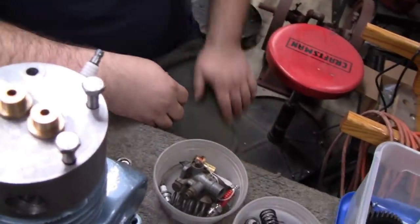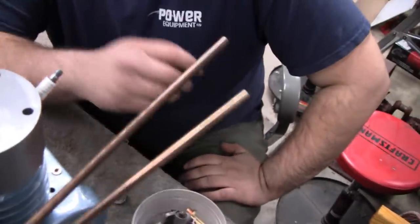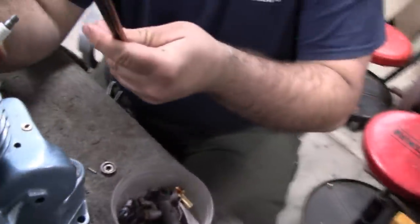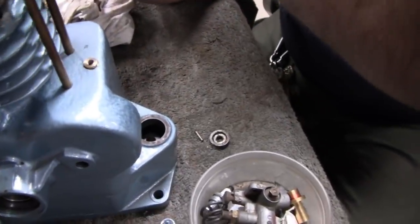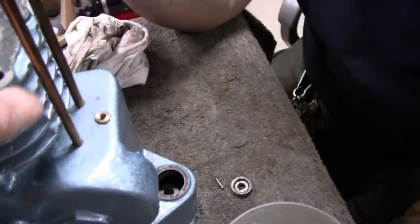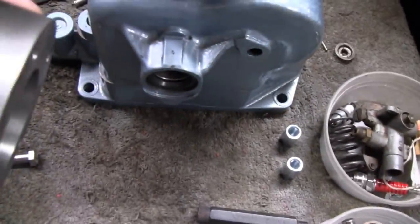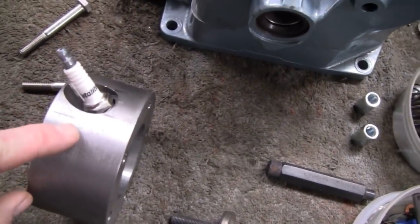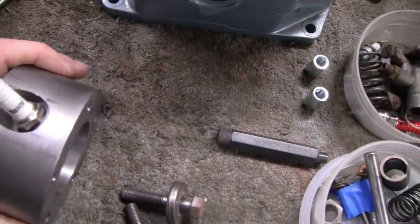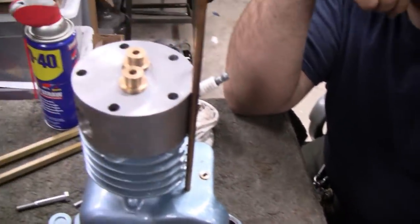And there's one thing that I have to do, and we'll get everybody put where they belong. Have to move that a little bit. Right, we got the holes here, and I don't know if you see, but there's little grooves I cut out for clearance, and there is no clearance on the head yet. I marked it out, but all I have to do is get a file and probably indent it maybe a 1/16 of an inch or a little bit. But anyway, we really can't do anything until I do that, and that's probably going to take an hour or so.